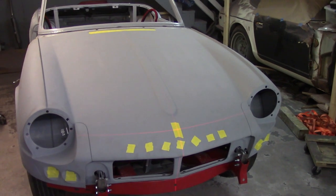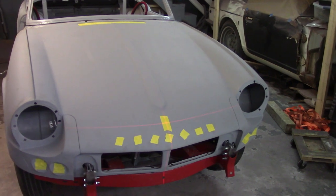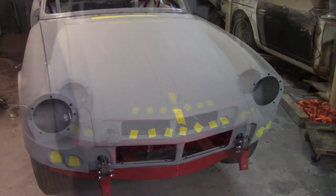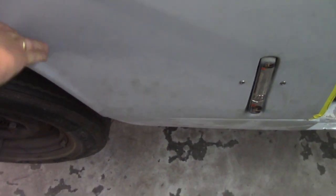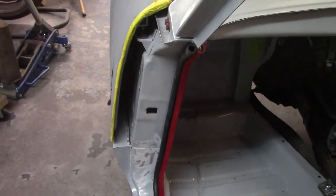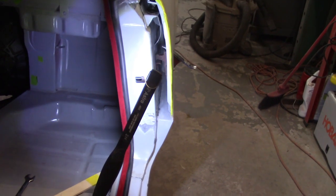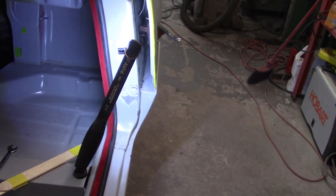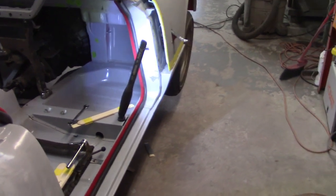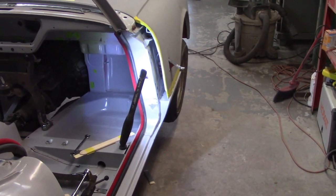I don't think I've ever loosened all the pivot tubes at the same time and then wiggled the bonnet around - just trying a different method to get to the same end state. I am happy with where the bonnet is. These gaps up here came in okay. I've still got a lip to contend with but I'll use the center transverse support for that. I'm pretty happy with the gap in the back and the shape on the other side. I have some hammer and dolly work to do as it gets a little out of shape about three or four inches off the sill.